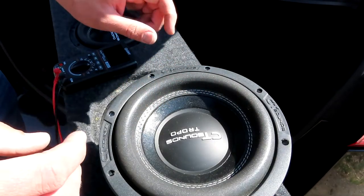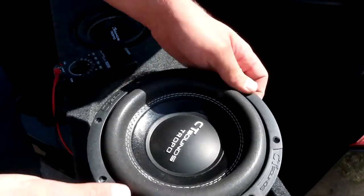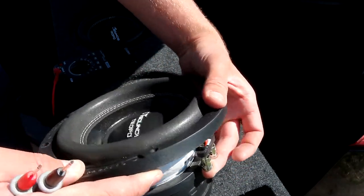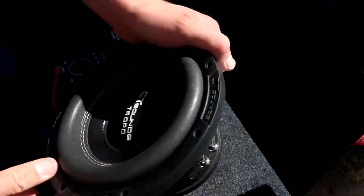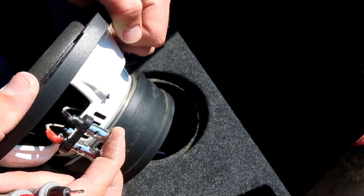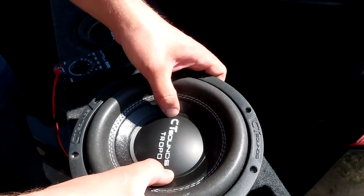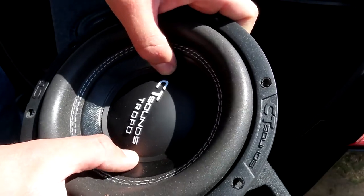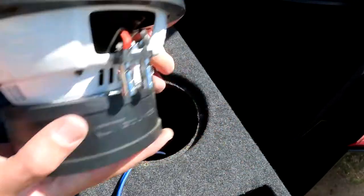So if you're having an issue and it's not playing, and you pull your speaker out of the car and test it and it has a coil that reads really funny, then the speaker itself may be bad. If it doesn't read anything or reads really really high, the speaker would be no good. Plus you can push on the speaker evenly and if you hear any scratching sounds, it's a dud — throw it away.